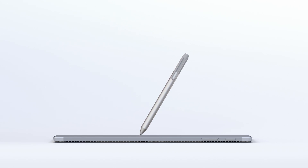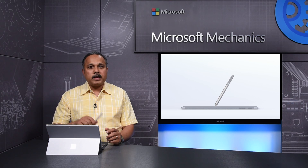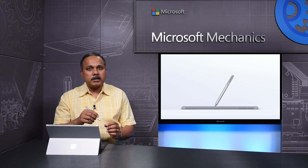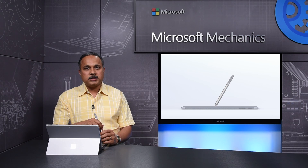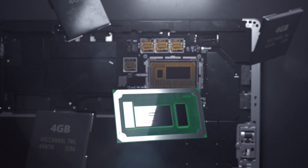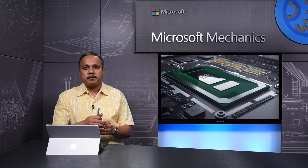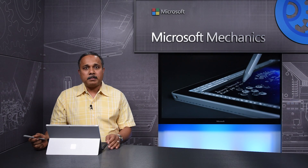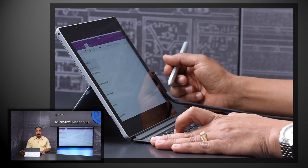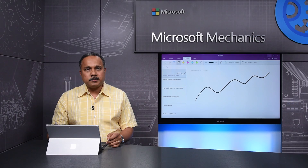Finally, there is inking latency. We want the ink flow to appear instantly and keep up with the path of the pen. Like parallax, any lag makes it difficult to draw with accuracy. To minimize latency, we use the speed of the GPU and the latest Microsoft G5 digitizer chipset. We also have optimized all the interactions across the stack — from the pen hardware to the digitizer to the operating system — and even worked with application teams like OneNote. As you can see, the experience is a fluid interaction. The inking just keeps up.